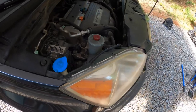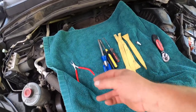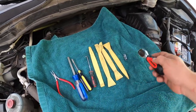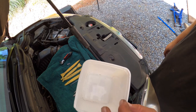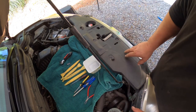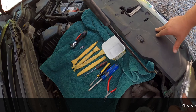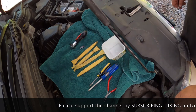These are some of the tools that may be required: a small needle nose, cross tip, flat tip, right angle pick, and some trim tools. Also a 10 millimeter socket and ratchet, and might need an extension. Since I'm going to be removing a lot of nylon retainers, I've got a little container to put them in. Be prepared, especially on a 2008 Honda CRV, that many of these nylon retainers are prone to breaking due to the age of the vehicle.